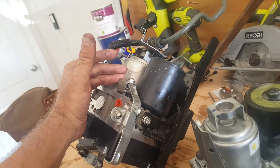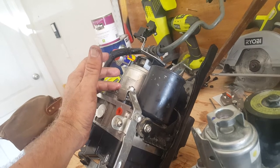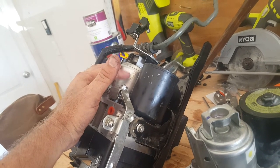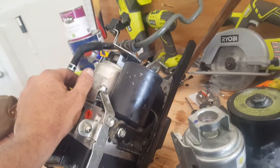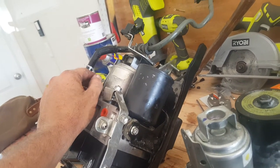When you do this, the coolant for the inverter has to be drained — no one talks about that in the videos. You've got to drain the coolant, and when you take off the brake line, brake fluid is going to pour out and make a huge mess. No one talks about that on the internet.